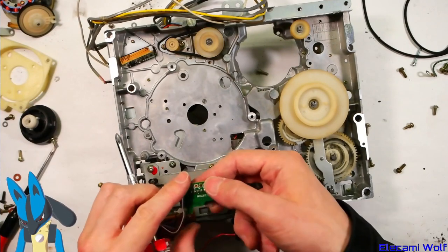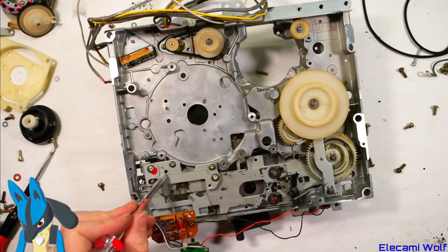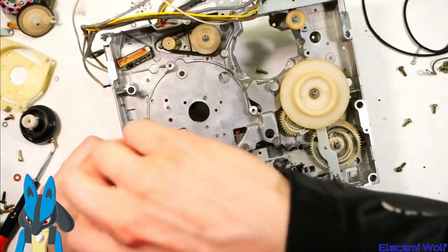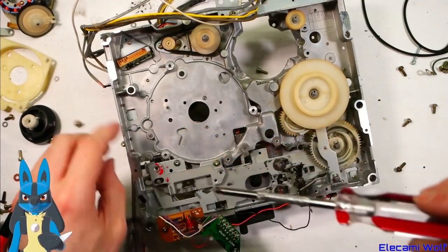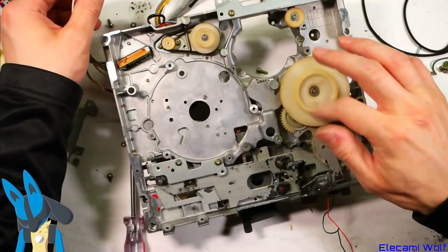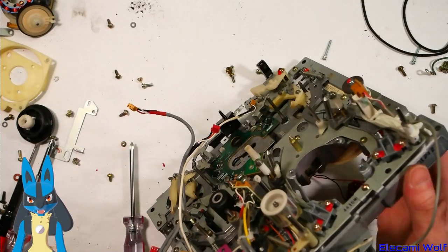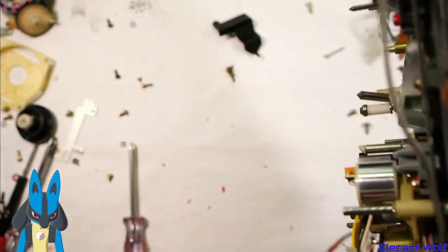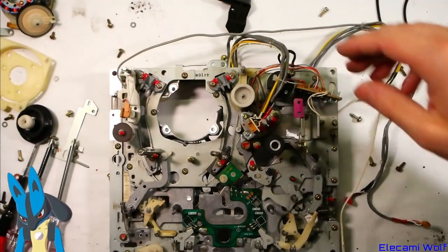Down at the bottom we've got the mode switch — a slide switch with a bunch of different positions that keys into that and can be calibrated. Some glue has been put on it. There's a slotted thing too that can adjust to set the exact position for the mode switch. And those are just gears which wind out the loading arms, bringing the tape out and wrapping it around the head. There's a dew sensor in case the temperature changes and condensation starts forming on the head, which you do not want.